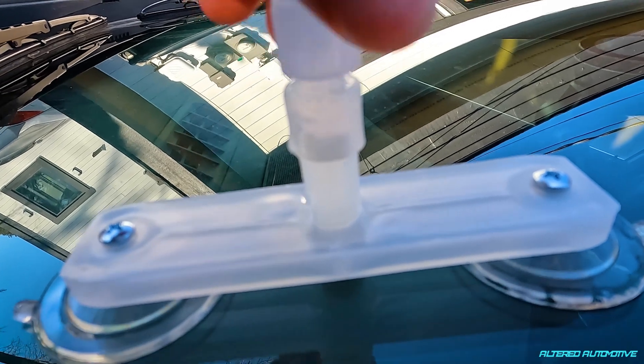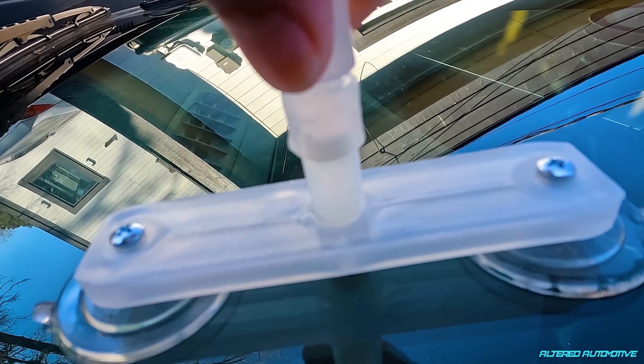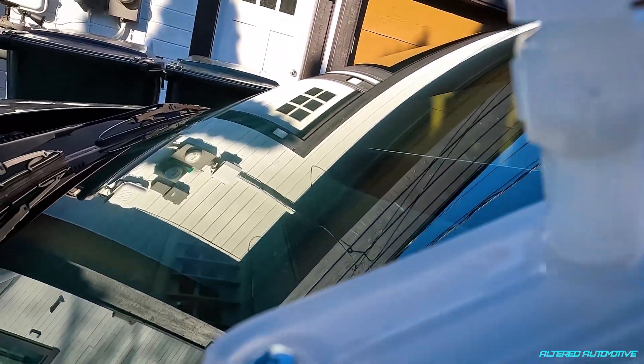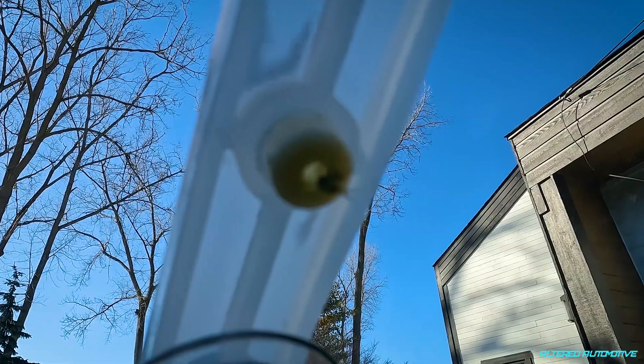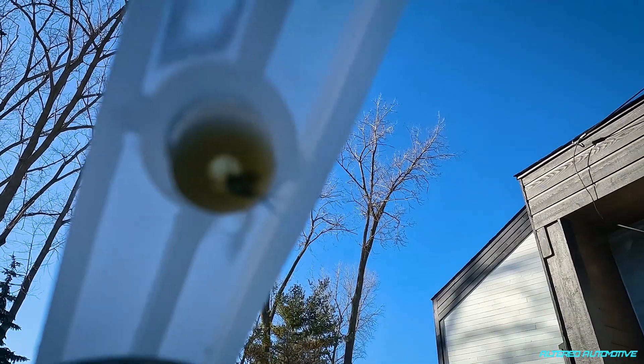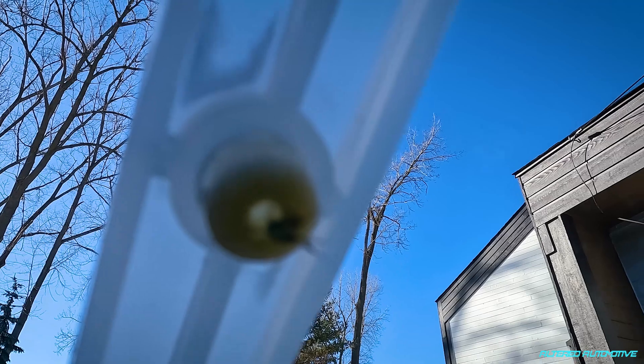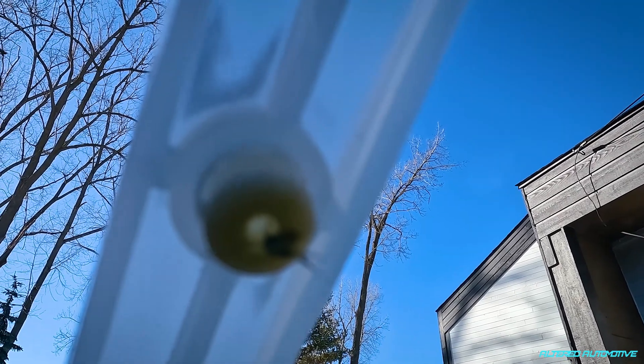Got some leakage. That feels pretty good. From the inside of the car I'm not perfectly on the crack, but the hole is lined up with it enough where the resin should fill it in for the most part. So I'm just going to go ahead and let that sit for a few minutes, then we'll take it off and lay the clear film on it.